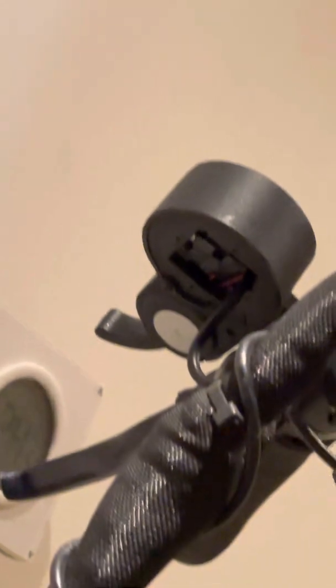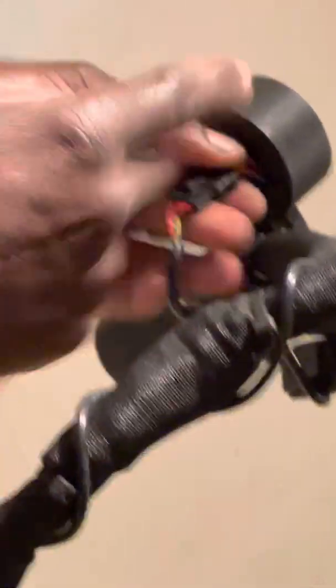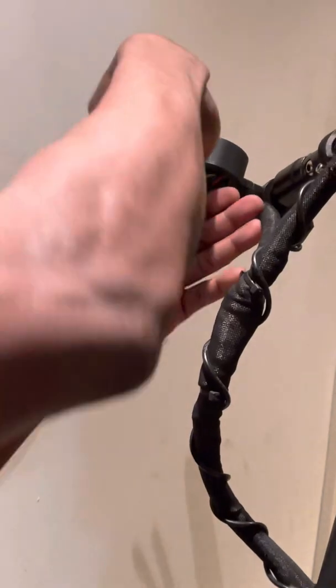You can see that's out. Set the old one aside. Pull this wire out the same way — press on it and pull it out. Now we have the wire that's connected to the controller and the throttle body alone. What we're going to do now is pick up the new one and plug it in.